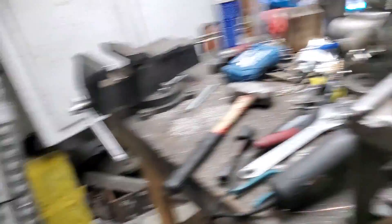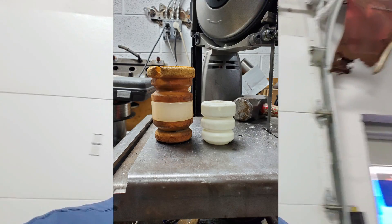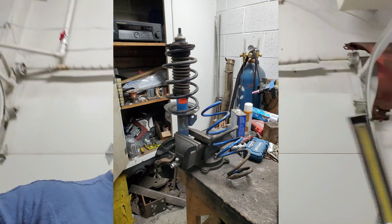I'd already trimmed it, so we'll get to that in a minute. I checked the car at ride height on the stock — I put stock springs back in maybe two years ago, still on the Tokico Blues, and it still rode the same. Still rode like garbage. And I think part of that is just the valving. So the other day I got an idea: how soon am I engaging my bump stops?